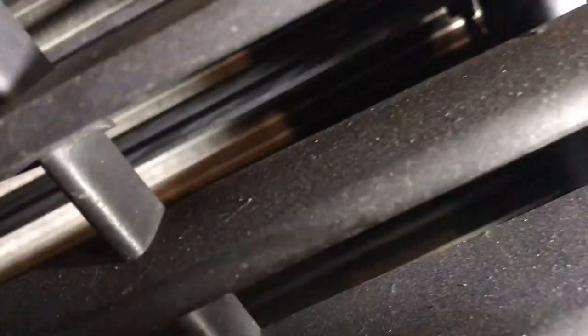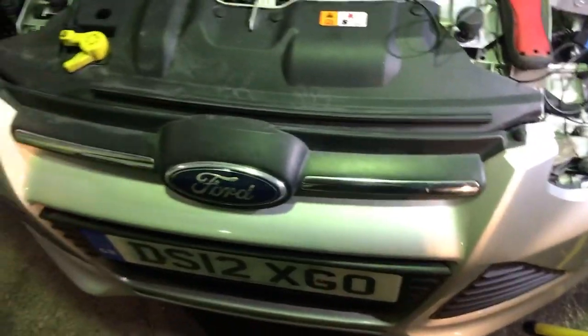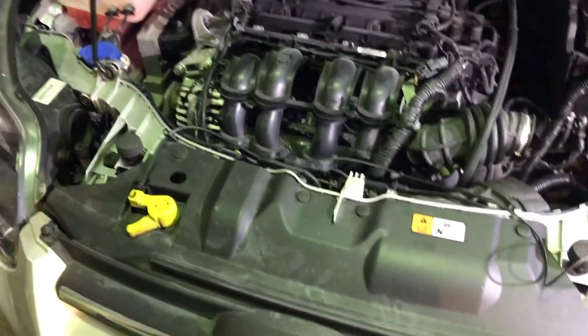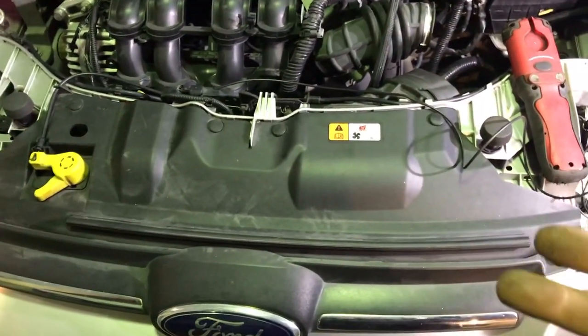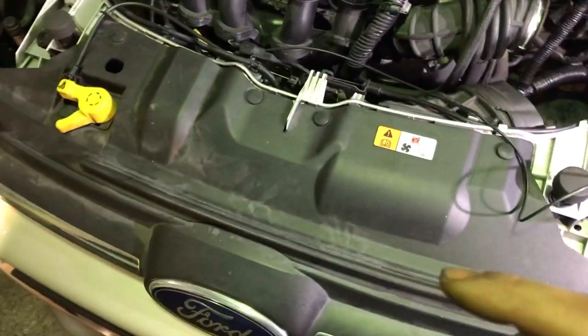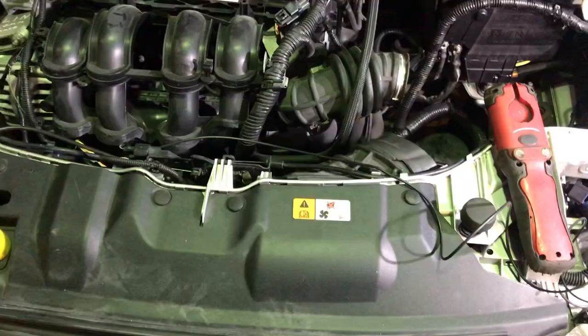The grill shutters are a series of flaps inside the front grille that open and close for different cooling temperatures, related to fuel efficiency and aerodynamics. The reason this matters is that they share the same signal wire as the alternator. So if you're having charging problems or a battery light, don't discount any information regarding the grill shutters — it could very possibly be the same issue.